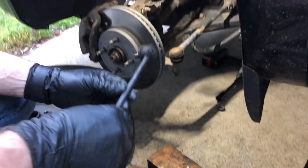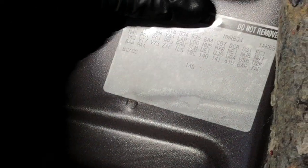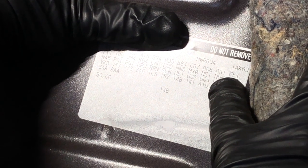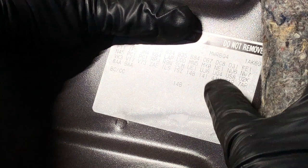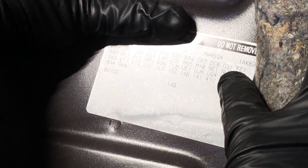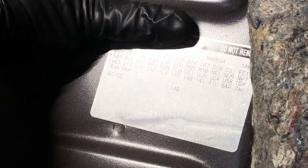Let's talk about what we replaced this with. To determine the correct part, we're going to go into the trunk. Lift up on the driver's side carpet and you'll find an option sticker in the back of the vehicle. The code we're interested in starts with FE on most of these models — this one is an FE1. You might also want to take note of a 6A type code, because on older 2005 or 2006 models it may be relevant. But for the stabilizer link, you're just going to need the FE code. You might need the other codes for springs or struts.